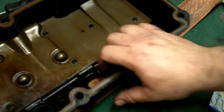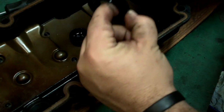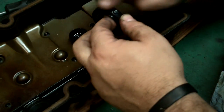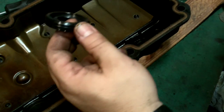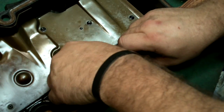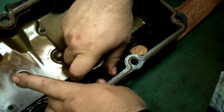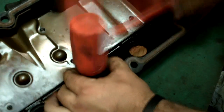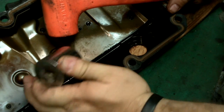Take my oil, a little bit on the outside. I'm just using some 30 weight oil that I use on the lawn mowers - not using anything in particular, that's just what I had open. Put this here, set our socket inside, and we want to hammer this level so it seats properly. That's it.